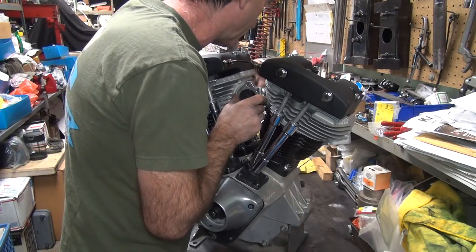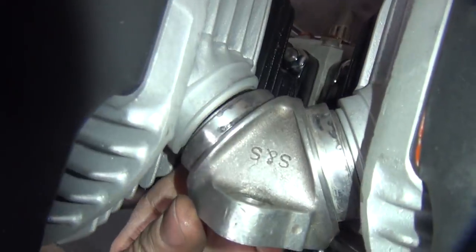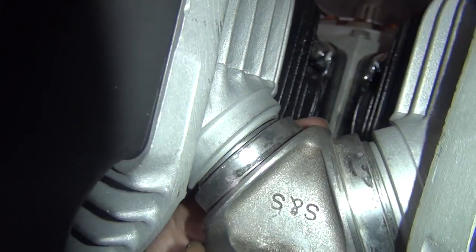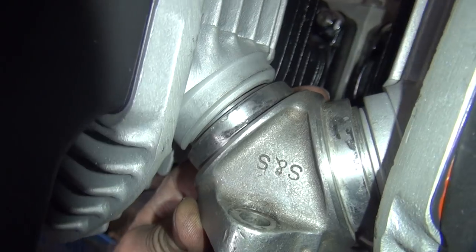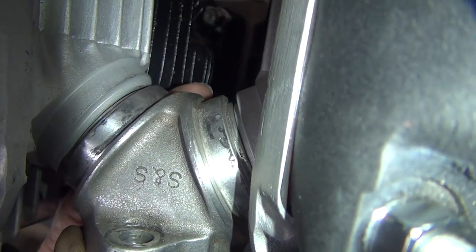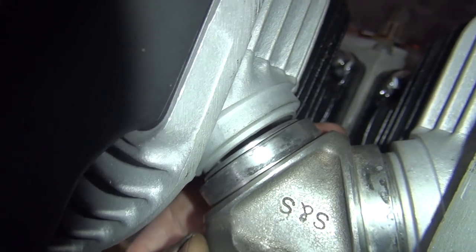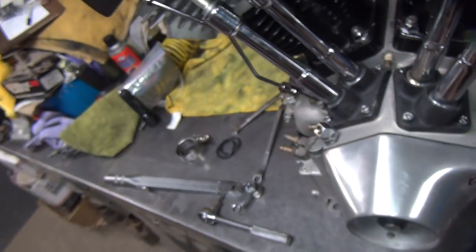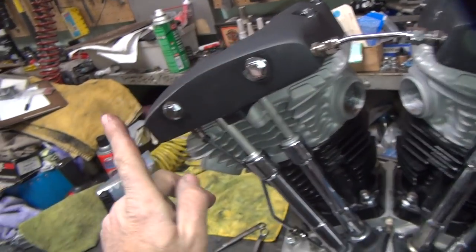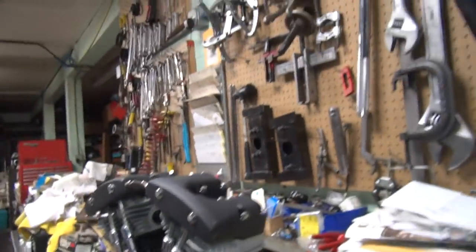Right now it looks like the front head lines up and the back head is too far rotated inward. I'm going to put the manifold on there to figure out which head is lined up. See how the rear one is too far inward and the front one looks lined up fairly decent. If I line up the rear one, the front one is right there — but see where the rear one is, it's way off. So I've got to kick it out to line it up. Right now it's kicked all the way this way, it needs to come the other way. This one here is bottomed out and looks like it's probably okay the way it is.